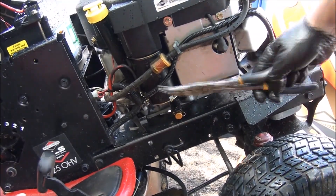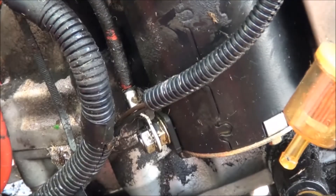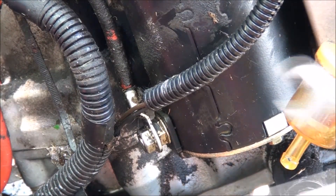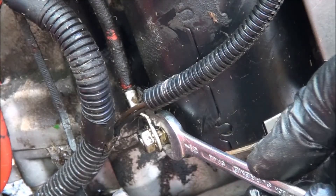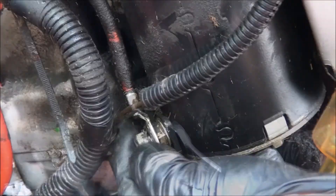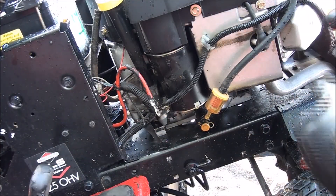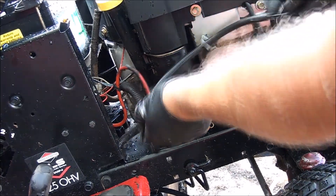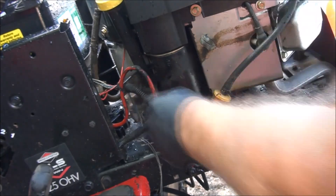This engine is now completely loose from the frame. As long as you keep the fuel line higher than the gas tank you won't have to worry about gas draining out. Let's disconnect the fuel line — clamp. Now we need to remove the starter wire, it's a 7/16ths. I use two wrenches, one is kind of thin to get in behind here because there are two nuts, then use the other 7/16ths to loosen. Somewhere in here we have a connection — I'm going to have to cut that zip tie to see what's going on.